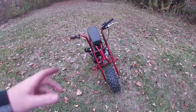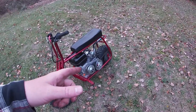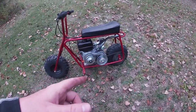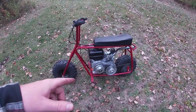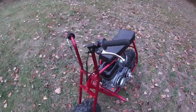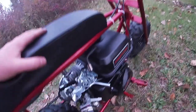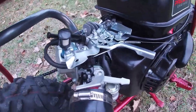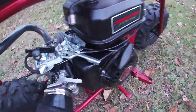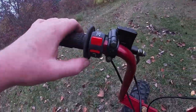It's got the torque converter. I forget what the drive gear is and I also don't know what the rear sprocket is. No governor — stage one. The plan is to eventually turn this into a stage two with a billet flywheel, billet rod, all the good stuff. I had to redo the throttle linkage because the governor is removed, and I put the return spring right into the flywheel puller.